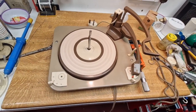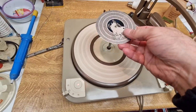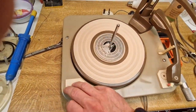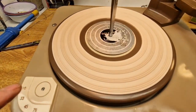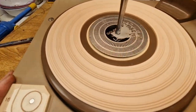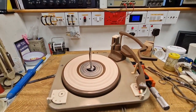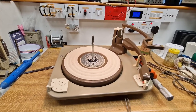The deck's all been cleaned and as I say it looks a million dollars — these UA14s always seem to come out really well, such a lovely deck. What I'm going to do now is stick my strobe on. I've got a light I hang over the top because the workshop's predominantly on LEDs. This is a strobe disc so I can check the speed. 78 is running just fine. Slow it down for 45 — absolutely fine. And last but not least, 33 — so that's all working as it should. The speeds are spot on. Final bit of cleaning up on the tonearm, I've got a new cartridge in, and then it's back in the cabinet.